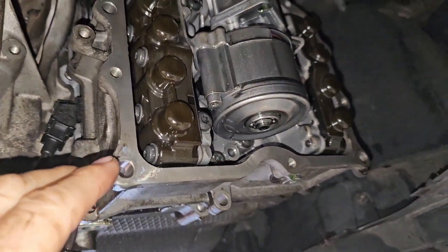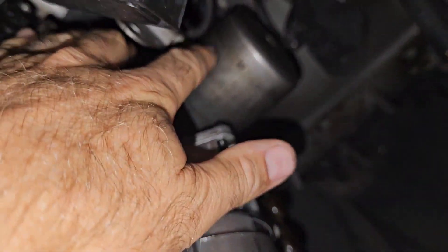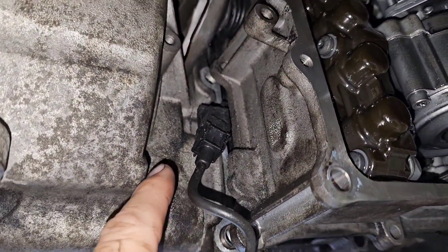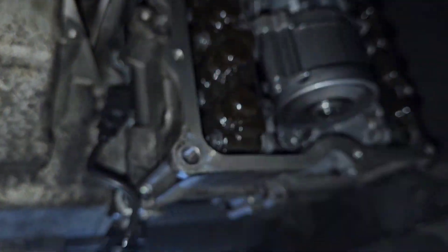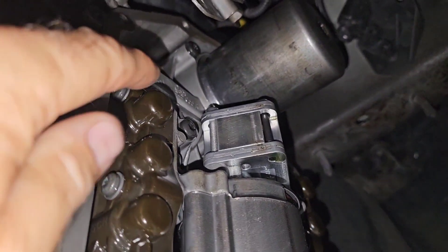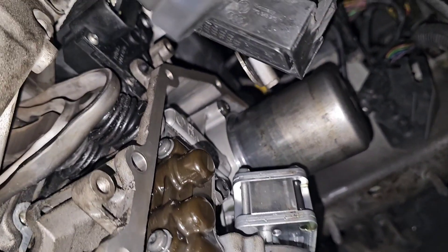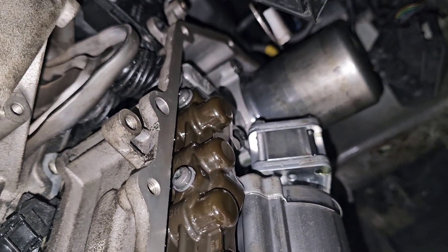I've taken the black cover off now. This part up here is the part that fails apparently — those two codes on the scanner indicate it's this. You can buy these off eBay, German, about 120 quid with the oil, new seal and everything. I've had to order a new tool — it slides up here to push these two forks out the way, twist it, pulls out of the way, and then this will come off square. It's on four forks behind here so it's got to come off straight. I need to take this off so I can inspect the casing because apparently it's quite weak around the top where this screws into — I just want to make sure there's no hairline crack losing pressure. I'm pretty sure that is the part.